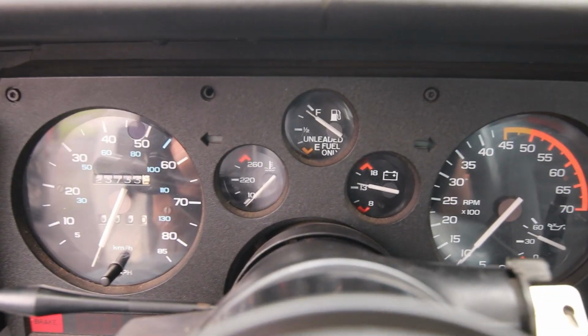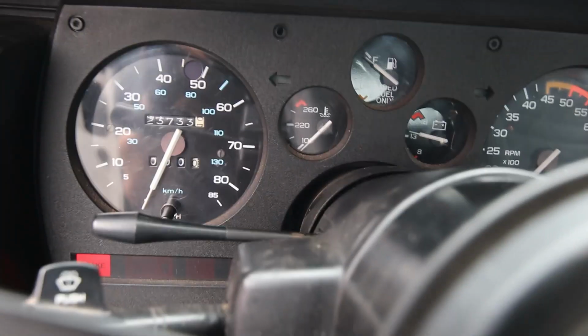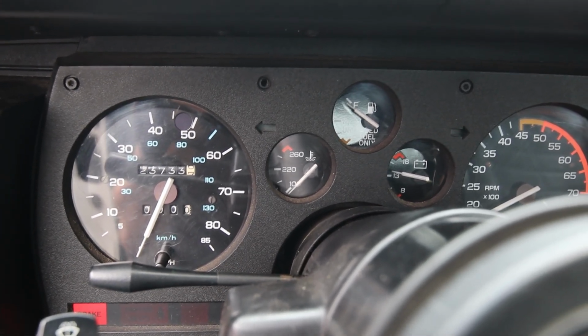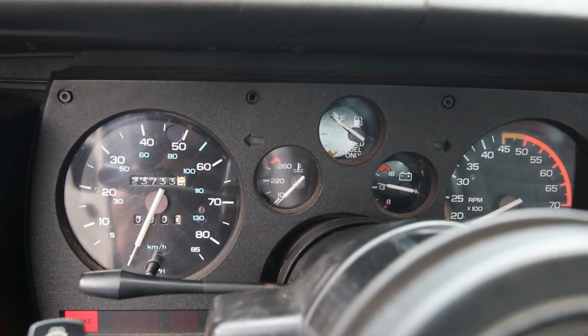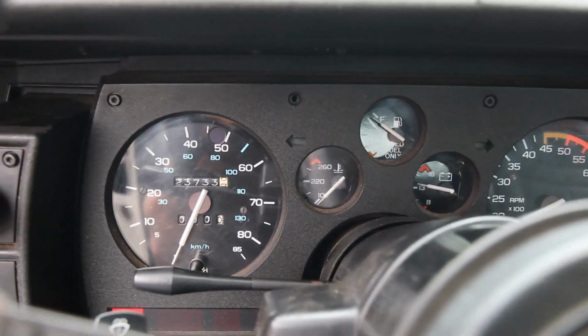Alright, so it's been running for a few minutes outside and it's creeped up to right under 100 degrees. I've got the coolant level pretty well topped off, so we'll see if it actually goes up to operating temp. I'm really hoping this is going to be the fix. I mean, I showed that the gauge does work. It'll sweep all the way hot when you peg it with like a torch. So in my head the gauge works. Hopefully that coolant temperature sender works as well.